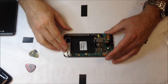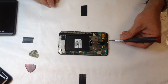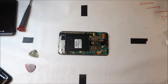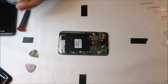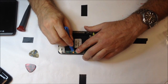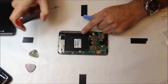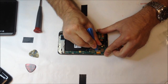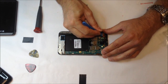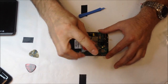Once we have the back panel off, there are several flex cables that you need to disconnect, and an antenna wire. Take a very close look at this — before you pry anything, make sure you have everything disconnected. You don't want to end up buying more flex cables, especially on a newer device, as they tend to be not only pricey but also hard to get a hold of sometimes. There are also a couple of screws — probably two — that hold the logic board in place.